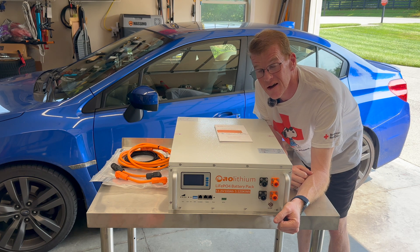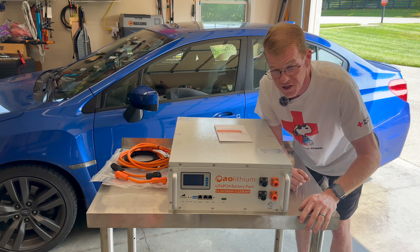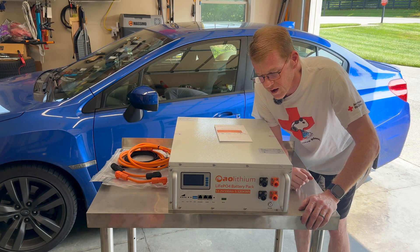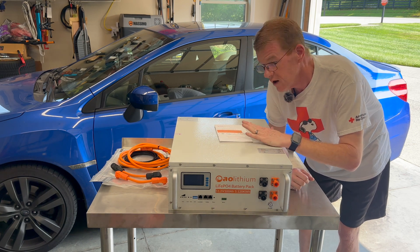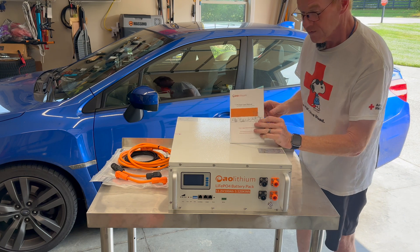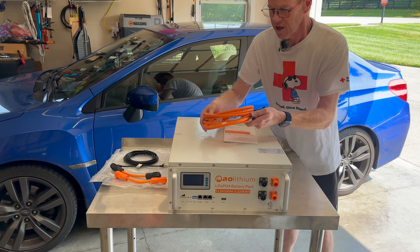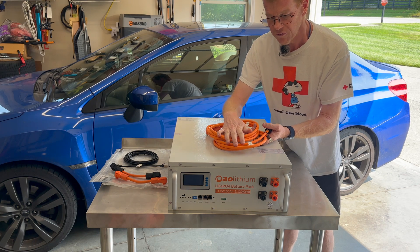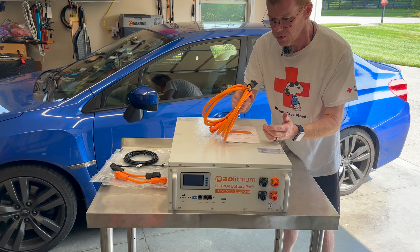It is now the next day. I relocated the battery up onto a table so I could get some good light and open it up properly. It's all out of the box. We've got an instruction book. They sent a set of cables — these are two meter, 25 square millimeter cables, which I believe is four gauge equivalent in metric. It says minus 42 to plus 125 degrees C on the side — they are very flexible, some sort of very flexible construction, not silicone.